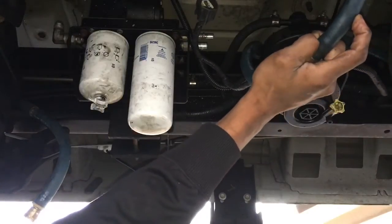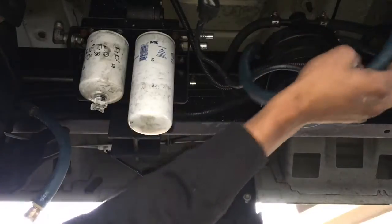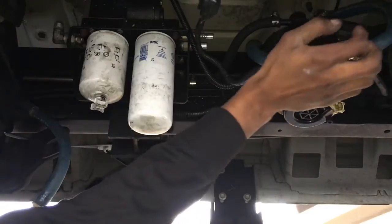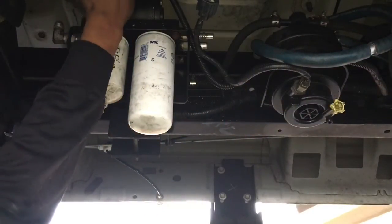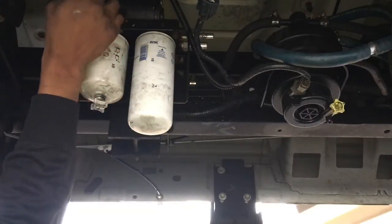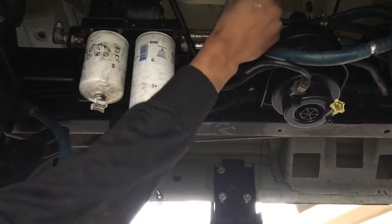This is my feed line going into the factory. Nothing but air will be going in there. The AirDog primed earlier but didn't come on. I guess I should check to see if it's getting power — I'll bring my meter out.